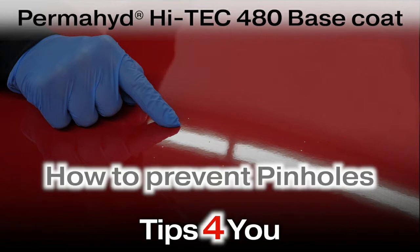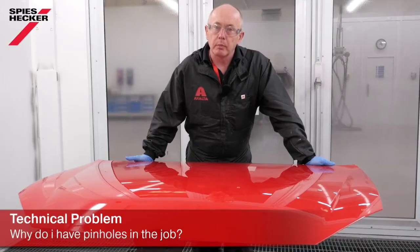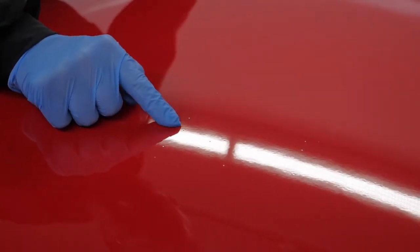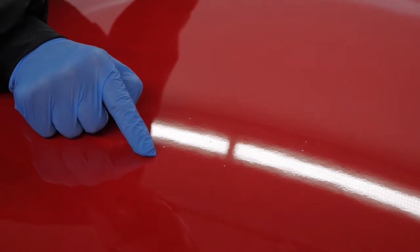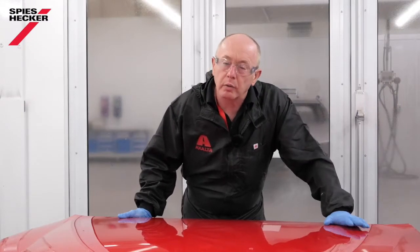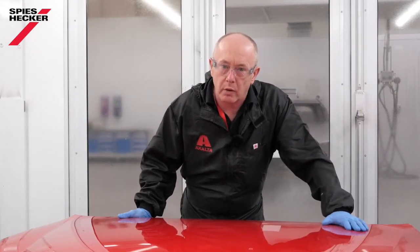You know, it's not often that I start one of these videos with a paint problem, but pinholes in the clear coat are a particularly frustrating and annoying problem to be confronted with, especially if you don't know what's caused them or how you're going to prevent them from happening in the future. Now, these defects are a result of mistakes made during waterborne base coat application.